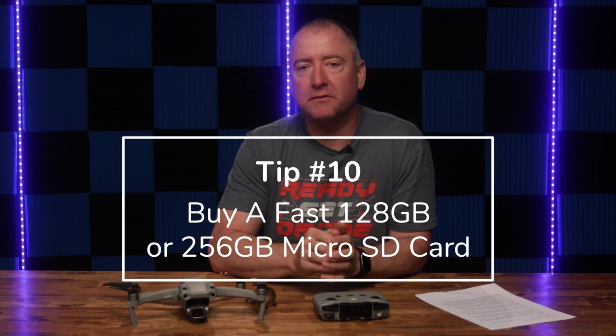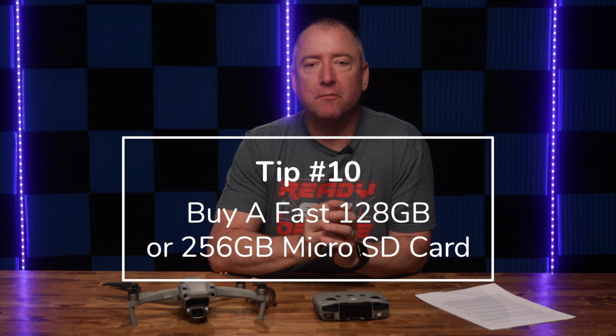Okay, and finally, my last tip for the DJI Air 2S to get the best images possible is to invest in a 128 or a 256 gigabyte fast micro SD card. Now, I know 32 gigs and 64 gigs was plenty for most people before, but honestly, if you're shooting 5.4K or you're recording all these raw images or you're doing hyperlapses and recording a bunch of photos along with it, you're gonna fill that card up very quickly. This thing will take up to a 256 gig micro SD card.